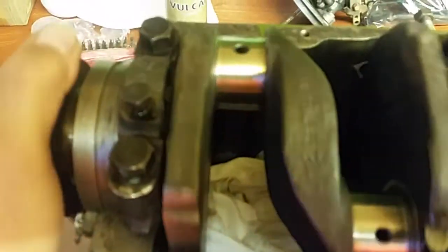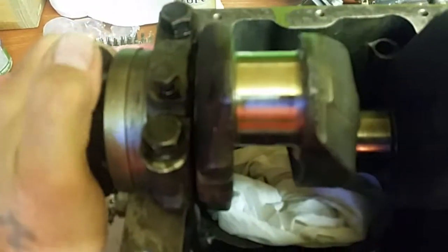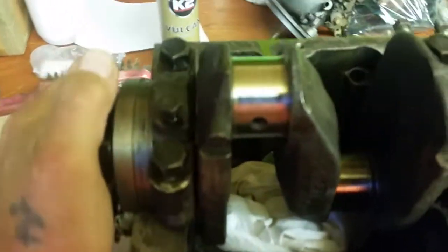If you want to waste your money and put loads of grease on, you do that. But there's enough lubrication on that crank — the engine will start within maybe five or six turns. You don't need to worry too much, as long as you've got something on there to stop it running metal on metal. So that's what I'd do there.